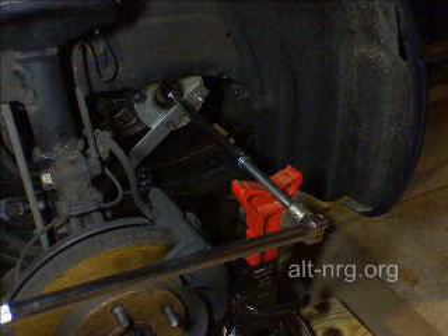So there it is. If you ever have to change a timing belt on an automobile with a four-spoke harmonic balancer like the Toyotas, this is very simple to make — it took me approximately two hours to cut the pipe and cut the notches with a hacksaw and break them out with vice grips. By doing so I was able to complete the task without spending a great deal of money. That's it for now — Zero Fossil Fuel. Hopefully I'll have time to get back to work, and I hope you are all having a wonderful new year.